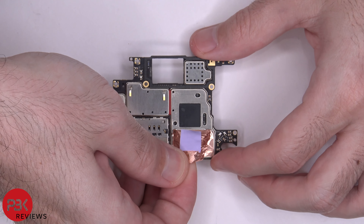You have two wire cables you need to pop off on your charger port board. Next, there's a cable underneath your charger port board that's attached, so lift up your charger port board gently enough to have some leverage to disconnect the cable underneath. Once the cable is disconnected, you can remove your charger port board.